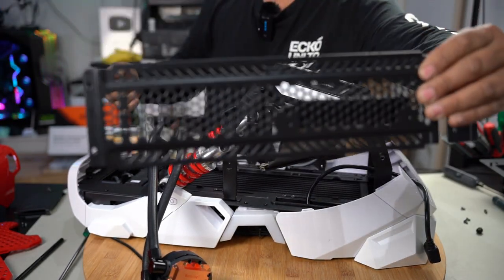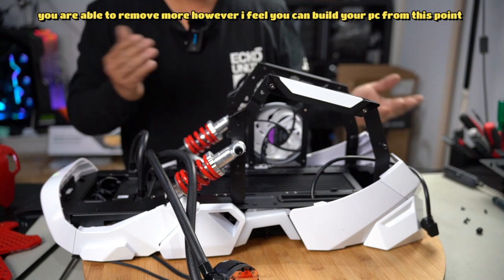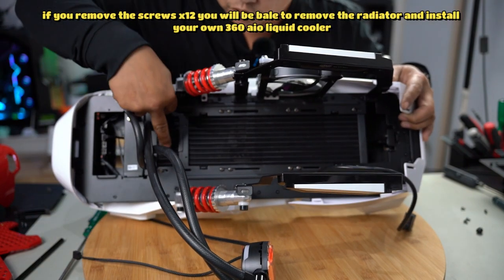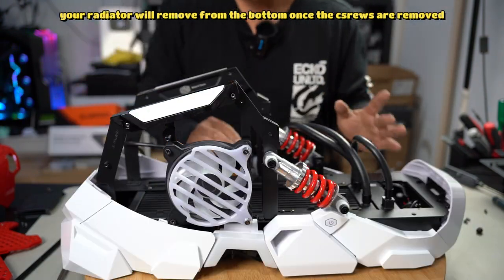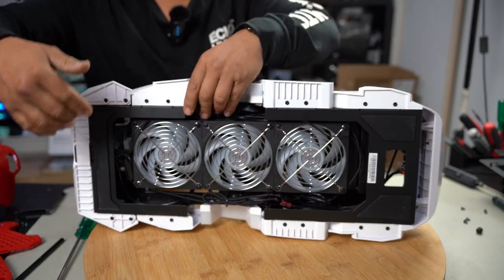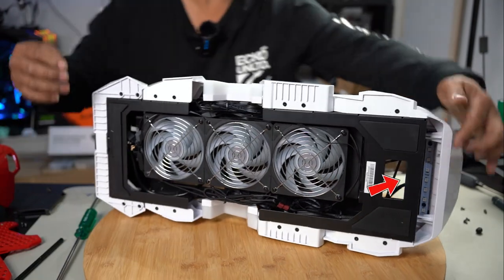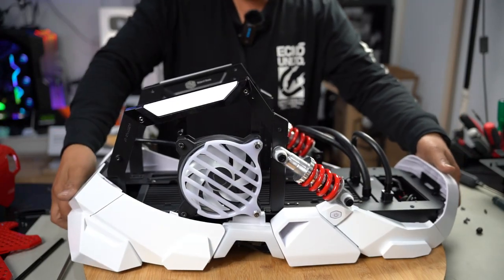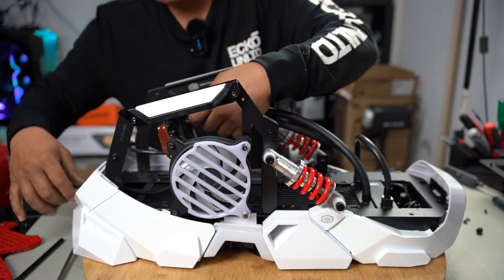Now you get a better look at your entire platform — it's actually quite spacious in here. Your GPU is going to be approximately 300–305 millimeters, so you'll be able to get a decent-sized GPU in here. To remove the panel everything sits on, grab it, lift to unclip, and slide it back — that releases the panel with the riser cable on it. That's basically the entire PC case taken apart. All that's left is the radiator, which installs like any radiator — 12 screws total secure it. Here's all your cable management; they've already daisy-chained everything together to one port, routing to the hub inside.